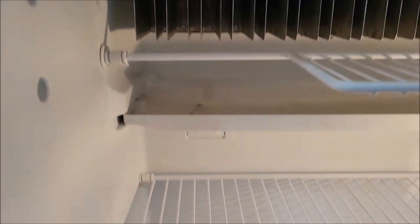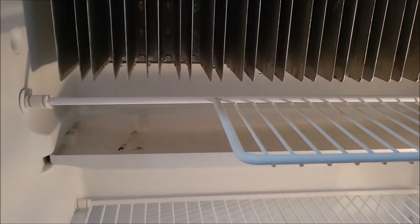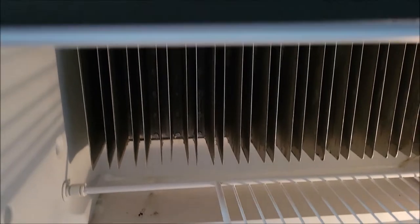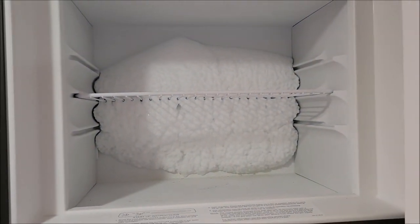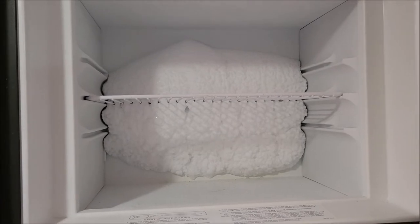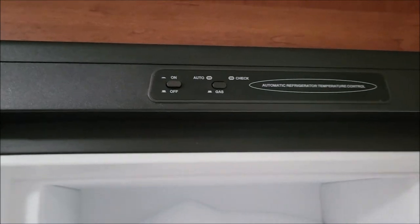On your fridge, there's usually a tray — a water tray that catches water dripping down and flushes it outside of the RV. There's not one in the freezer though. What we do is turn the refrigerator off — on ours we just have this little button — so the refrigerator is now off.